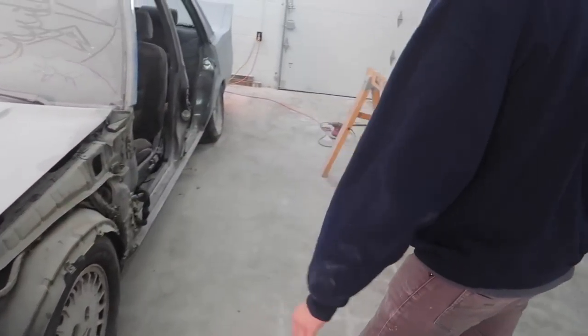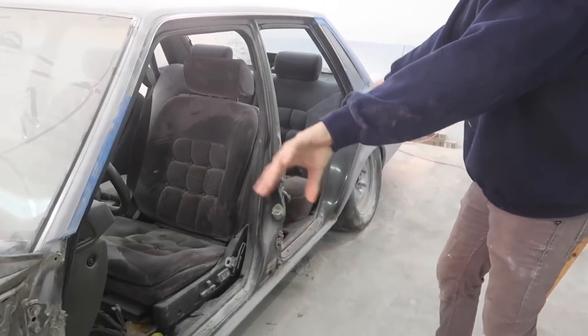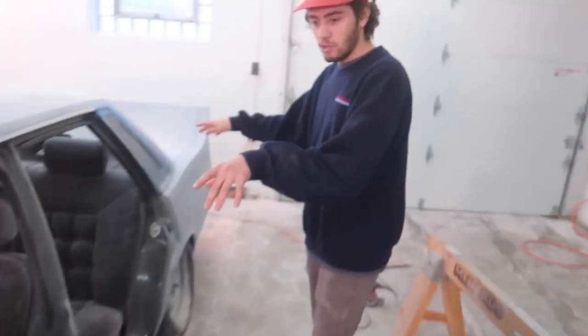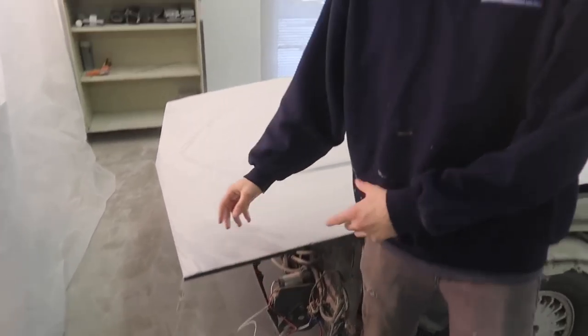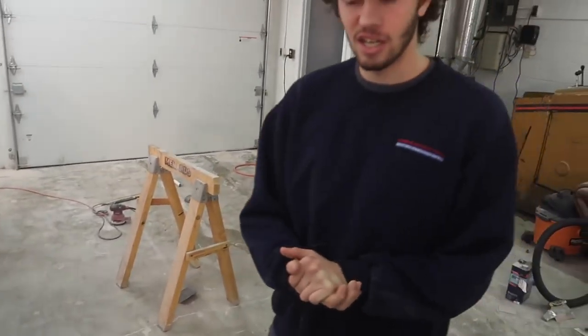What I'm going to be doing first is jacking up the car, taking off these front wheels, taking off this inner liner, and then prepping all this inside and painting it black. This is the jam that I'm talking about — we're going to have to take off all this trim inside here, prep it, paint it black, and then once we rehang the doors we can move on to finished bodywork through the doors and then onto finishing the fender and finally getting one of this long nose finished off.